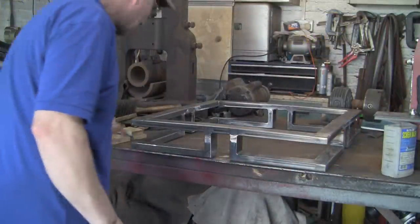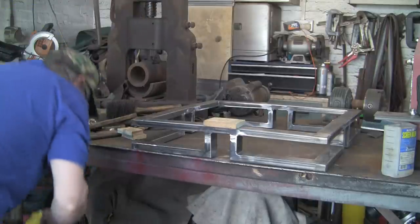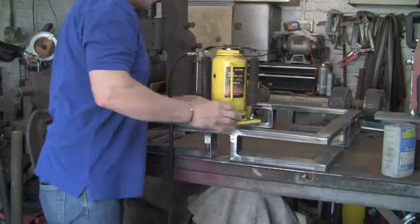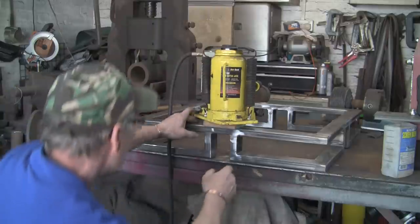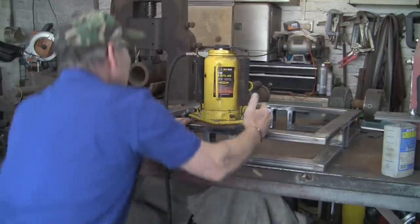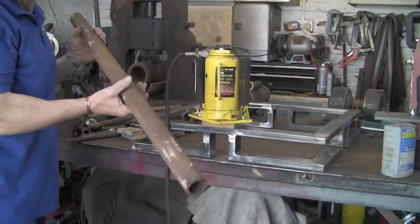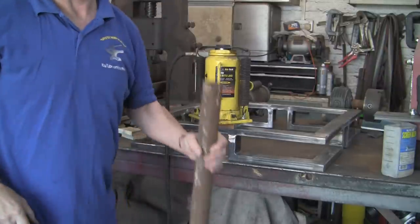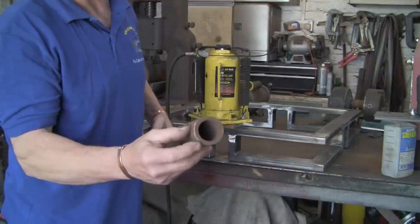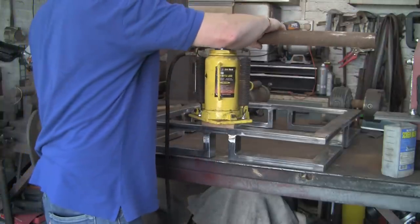What we're going to do — I'm going to use some wood to protect it. Cut a piece the width of the middle bars there. I'm going to put my jack on there. This is a 20-ton air-over jack, another eBay bargain — I think I paid about 30 quid for that. Just line her up, make sure we're bang in the middle. I don't want it pulling up oddly; I want to try and pull them both up together. It would have been better to be in a bit of channel or heavy box section, but you've got to use what you've got. I only use this because it's nice and heavy — about five-sixteenths thick wall on this, or at least a quarter. I've just put a ring and a couple of bits of flat on there just to sit it on the top of the jack so it doesn't roll off.